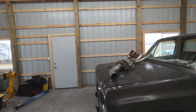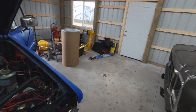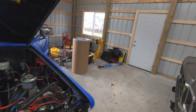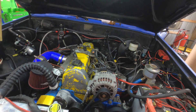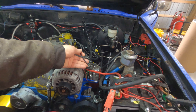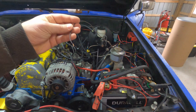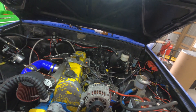And that's exactly how you do it in your swap if you're using a carb or whatever, or a non-PCM-controlled alternator. If you have one of those Holleys that does everything for you, it won't tell the alternator to charge, so you put a 470-ohm resistor in line — it drags it down, sees 11-point-something volts, and says time to charge. This one is not charging; Darrell's is charging. So I'm going to get the turbo setup off the hood of Darrell, get the hood open, and we'll start them both up and I'll show you how to check quickly with your multimeter that they're charging.